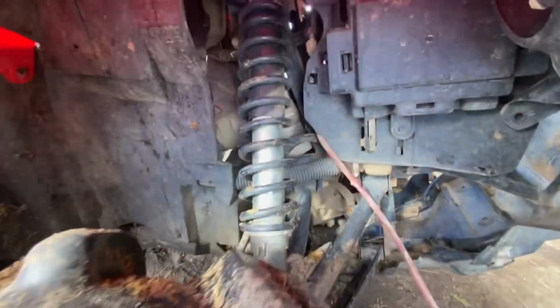So I got it lined up in there. You see the part that broke off. So my plan is to weld, see, this thing to this. That's what's supposed to be welded. So even though the sides are pulled out like that, as long as I weld it on there, then you can pound the sides back in, weld them up.